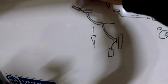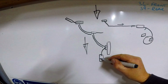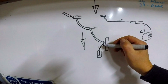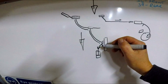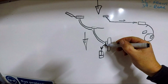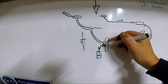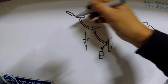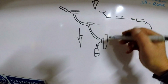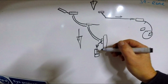Your lever is your actuator for the bleeding method. Keep some fluid in here and the one-way valve in here. Most people use the extra helper or a friend to help bleed the brakes, which is one of them spannering on here: opening the valve, pulling the lever, closing the valve, opening the lever, and just keep doing that and purging the system through. With this valve, it's doing away with your friend, so you don't have to buy extra beers.